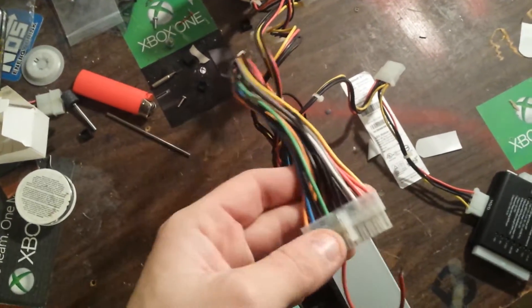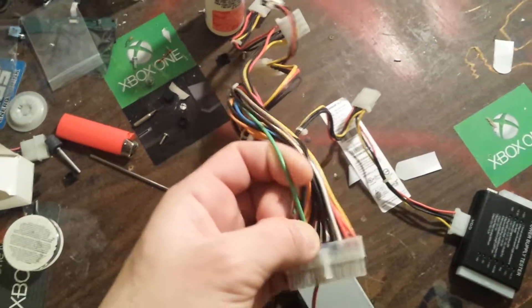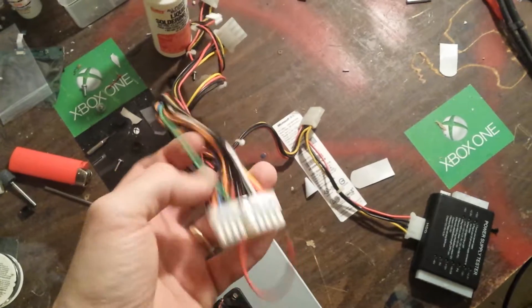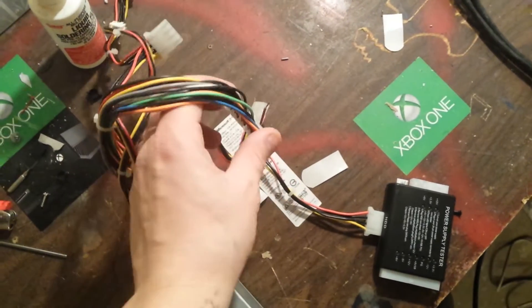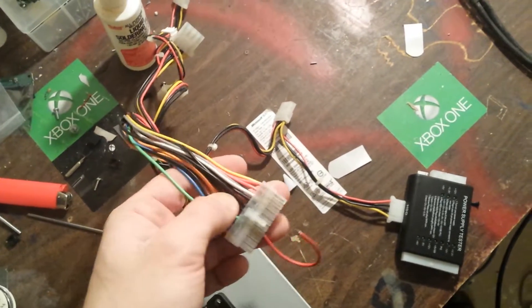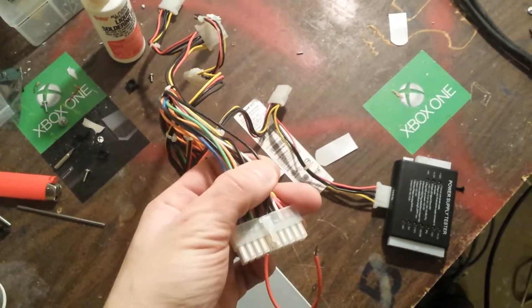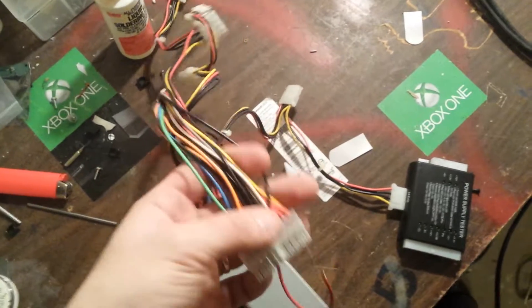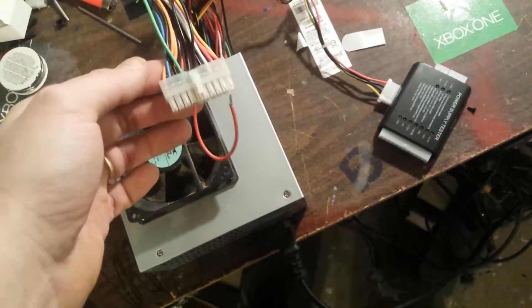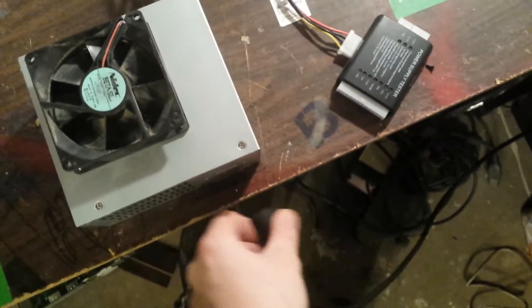As you can see, I've already got my wire in there. What we're looking for is the green wire — the green wire is the receiving wire. Pretend this is plugged into your motherboard: you push the button, it sends a signal through the green wire through the power supply, back out through the black to the motherboard, which completes the circuit and turns it on.